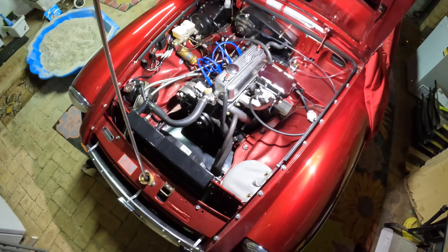I'd been meaning to tension down the cylinder head studs after about 500 miles of running, so I tensioned all that up, reset all the rockers, and started the engine. I could hear cracking on the spark on number three and number four, but it made very little difference to how the engine ran when I took those off. That pointed to something in this general area. I tried a spare distributor, wired it all up, set it all up — made no difference. After a break, I came back and thought about it, and the only thing I had changed was the servo connection on the manifold.